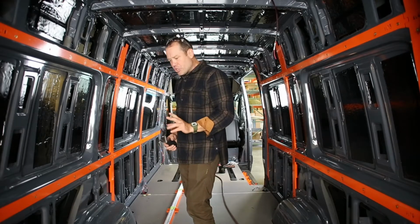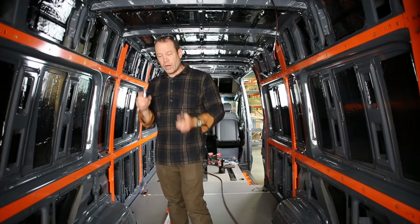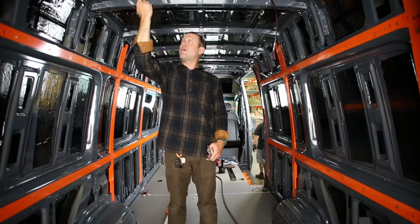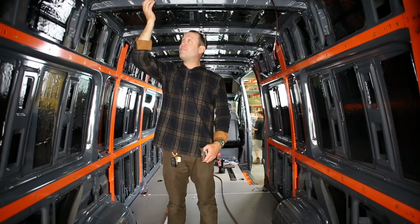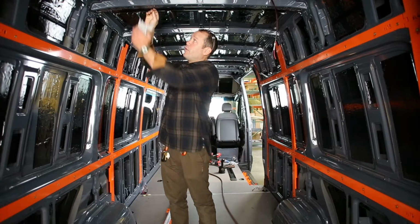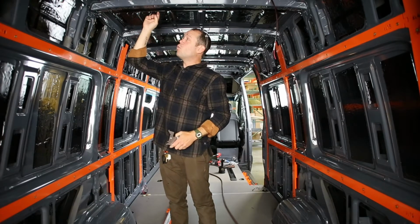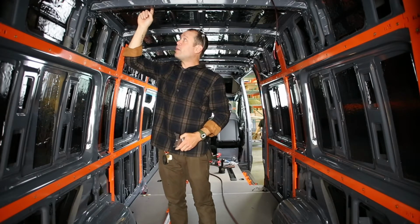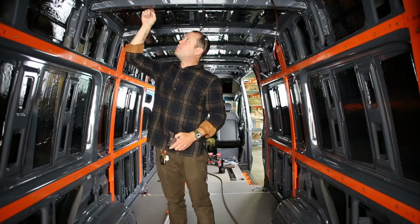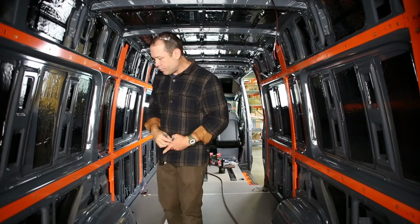And there's 2 different ways to do it. One is with the 1/4-inch stainless steel rivets, and one is with a through bolt. If you're running a through bolt, you're going to run one side, turn around, run the other side of that single bolt, slip your bolt through it with the washers on either end and tighten it down. When you're doing the rivets, it's important to do one hole, set the rivet, then move to the other hole. And you kind of give a little bit of a palm up and push that little collar up and punch that hole. You'll see it in detail right now.